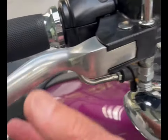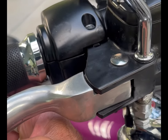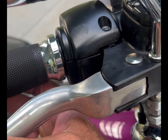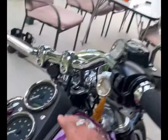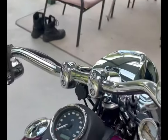When it collects dust and gunk, it had gotten so thick that when I pushed the lever in that was fine, but then it would only release to about there and the gunk would just hold it there. So what was happening is it was holding on my rear light — the tail light was on all the time after I'd hit the front brake — and the security system, which is hooked into the voltage regulation, was picking it up.